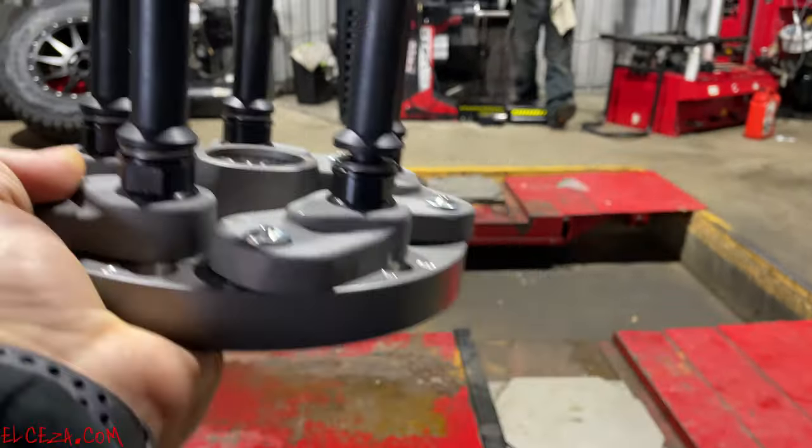Where is it going to ask me to put weight if that handle's missing? The first time I drop the hood, I guarantee you it's going to ask you for 3 ounces of weight plus whatever else it needs, right where that broken handle and bolt are missing. And then I'm going to drop the hood the second time, and guess what it's going to do? First time it balanced the butterfly. Second time it's balancing the rim. And then you call me saying, this son of a bitch is chasing weights. And I come out and the handle's broke or missing or maimed or been beat on with the rubber off of this. This is not the butterfly time.